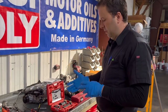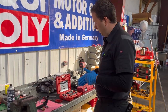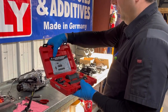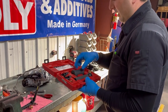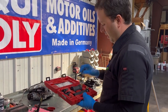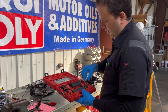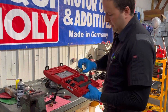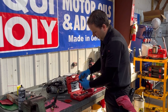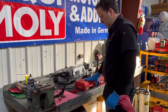When we remove the fuel injectors we reseal them — Audi offers a seal kit for that. This tool is necessary to perform the seal replacement: CTA tool part number 8877. It also comes with a slide hammer and a puller piece, but I don't prefer those. The only pieces of the kit I use are the installer, the comb, and the three seal installers. The slide hammer on this unit has a very short throw — I just don't like it.